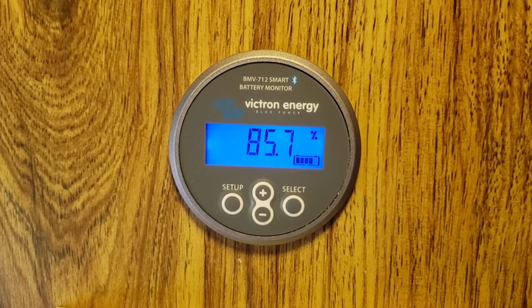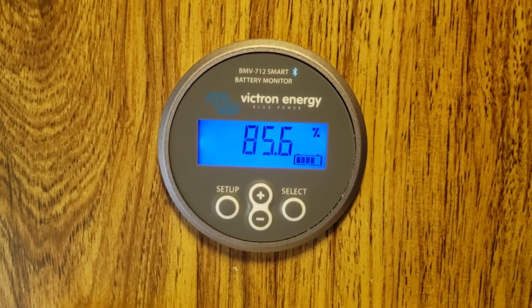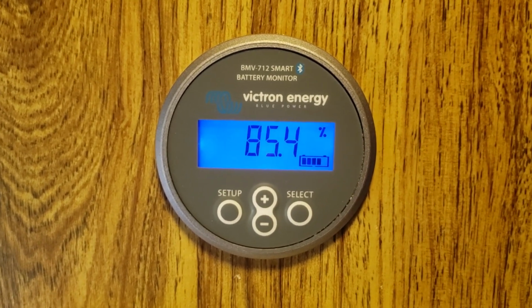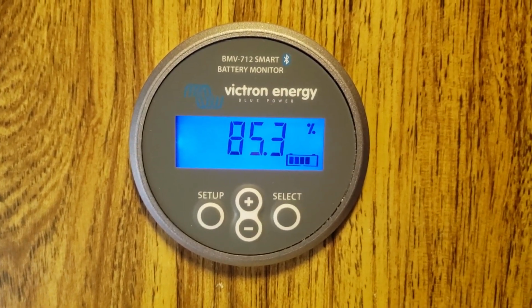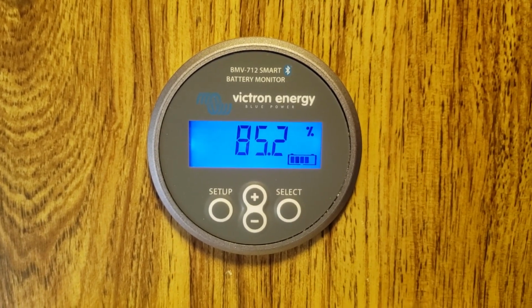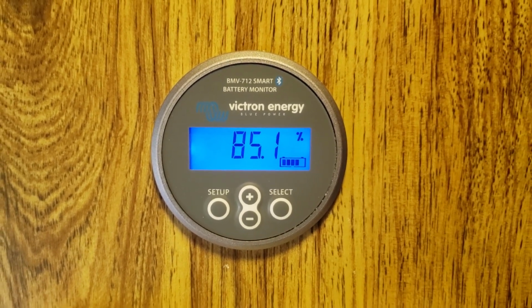You see how fast that is sucking down my RV system batteries? Two 100 amp hour lithium iron phosphate batteries, a really clean, top of the line 3000 watt inverter. So it's definitely handling that output fine. And solar coming in. I've got a little bit of sun hitting, probably getting like 2 amps or something coming in. And it is just sucking my RV dry.